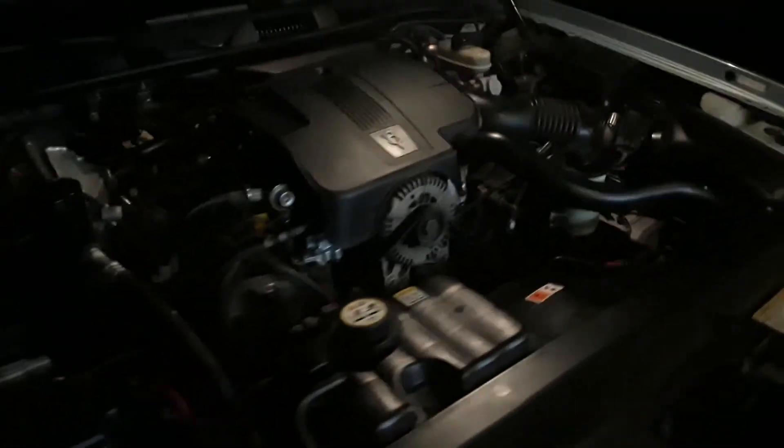This here's on the Crown Vic. We've got the F-150 SuperCrew over here, and this is just like the Expedition — you can see, kind of see in there, you've got that stacked plate cooler right there. That's a stacked plate transmission cooler. These have your transmission oil cooling lines running into the radiator of the vehicle, where they run through a small cooler in the radiator. It's sealed, but it makes contact with the coolant, which is already hot. So you're putting the heat from the transmission oil into the radiator, and then they have these external coolers. These ones here don't really need an upgrade — they already have them. The Expedition has it too, so these trannies are fine.